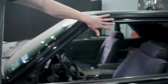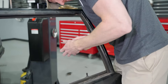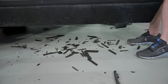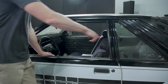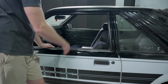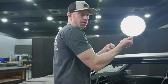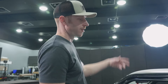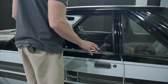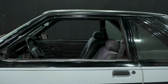Once your run channel trims are back in, it's time to install the run channel weatherstrip — and for that, the door panel has to be removed. Depending on the age, the old weatherstrip could come out in a few pieces or just shred apart; most cars we touch here, it falls out in several pieces onto the floor and down into the door frame — get your vacuum in there and clean it all out. A good tip with the run channel weatherstrips is to put a little dish soap on the backside so it seats right into the channel easily. While you're at it, think about all the other components inside the door you may want to replace while you have everything apart.